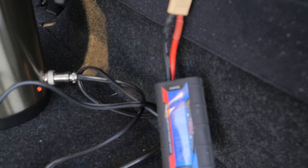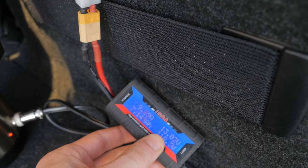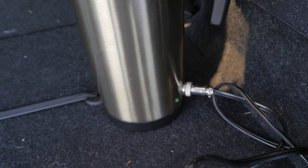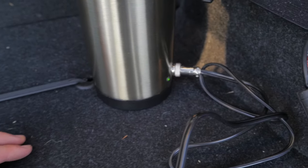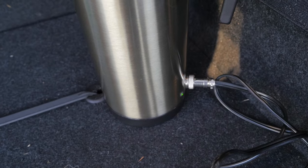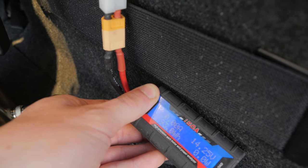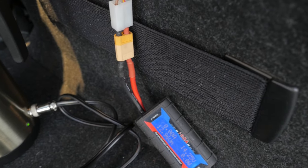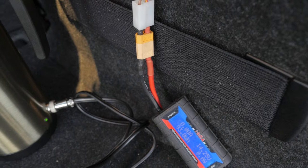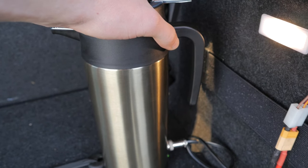Let's check how much energy it's consumed — and it's just switched itself off, the light has turned green. So after 45 minutes it's switched off. We consumed 7 amp-hours and 93 watt-hours, which in an electric car would only reduce the range by less than a quarter of a mile — practically nothing. It's ready now and it seems like a pretty decent kettle.